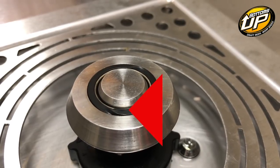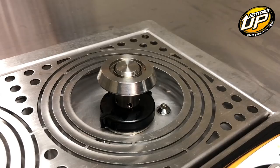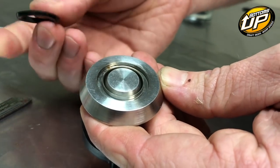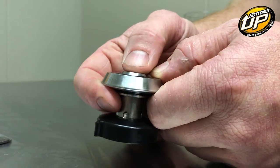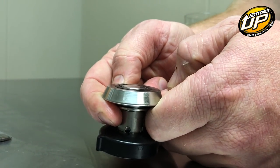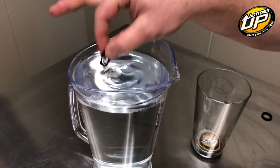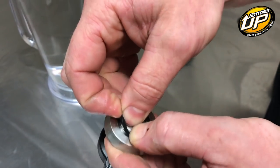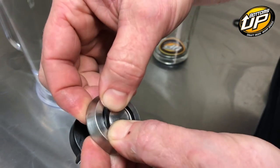The next most common is a twisted cup coupler O-ring. These are square-cut O-rings found on the top of the cup coupler, and it most often happens when an O-ring has been replaced. It is actually better to leave an O-ring out of a cup coupler than to replace it twisted. To fix the problem, remove the cup coupler from the dispenser, then remove the twisted O-ring. Take the cup coupler and press down with your thumbs on the center post of the nozzle to make it flush with the top of the cup coupler, making it easier to replace the O-ring. Wet the O-ring and the cup coupler and very carefully push it into the groove, stretching it as you push it in so it doesn't twist.